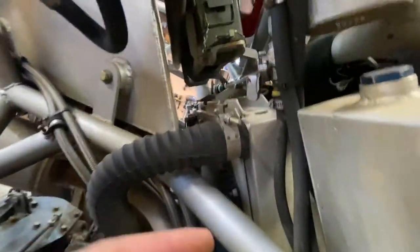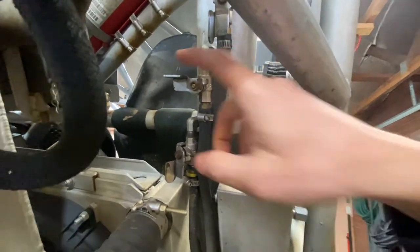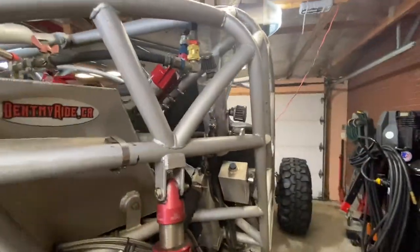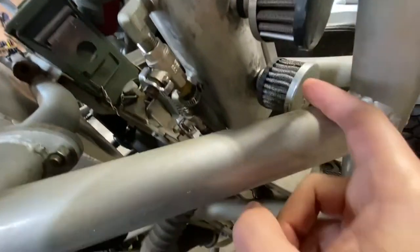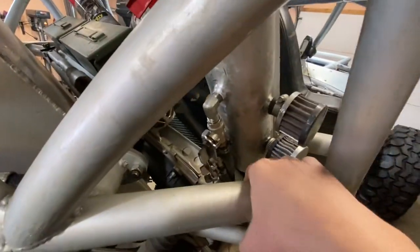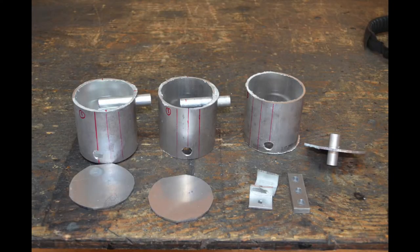The hose comes up into my catch can. This is a three-tier catch can with three different manual shutoff valves. The tank I built has three different compartments. The upper one is for the transmission, the middle one is for the transfer case, and the lower one is for the axles. Even though it looks like a single cylindrical piece of aluminum, I built it so the three containers are all separate from each other.